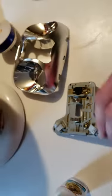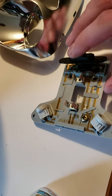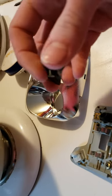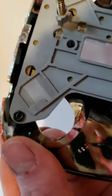When you put it back together, I recommend starting with everything laid out flat. Your little switch has a groove in it and will simply sit in there. It's got a little cylinder piece to help it all lay flat smoothly, and then the chrome reflector piece goes over top. Once it's all lined up, pop it back together — if you didn't melt too much off in the beginning, all four studs should pop back in. Then put a couple drops of super glue or gorilla glue on the bottom side and also use the soldering iron to re-melt those little dots back into a nice bead to hold it all together.